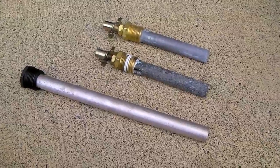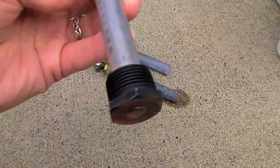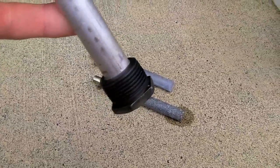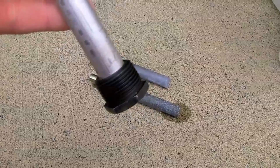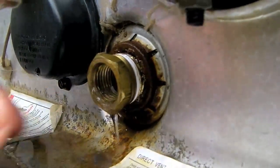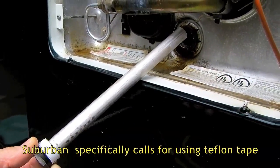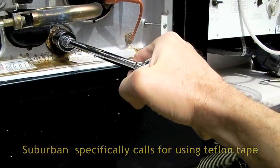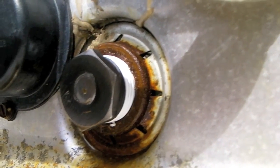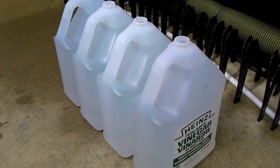So now I'm left with a difficult choice between an anode rod that may not protect the tank properly and an anode rod that may never come out again. We're going to reinstall an original equipment Suburban anode this year and risk that we may not be able to get it out. We're either going to have a difficult-to-remove anode next year or we may not be protecting our tank from corrosion. We had a heck of a time breaking the brass collar loose, so we've opted to go back to the original factory replacement anode rod from Suburban. We expect this rod will sacrifice itself much more than the aftermarket rod did, and we're probably going to try breaking it loose about six months from now to make sure it doesn't get too rusted in.